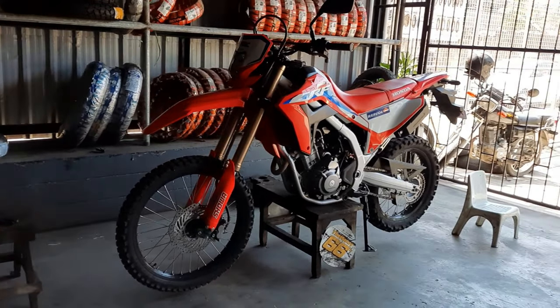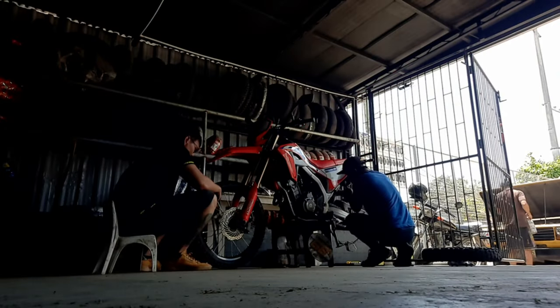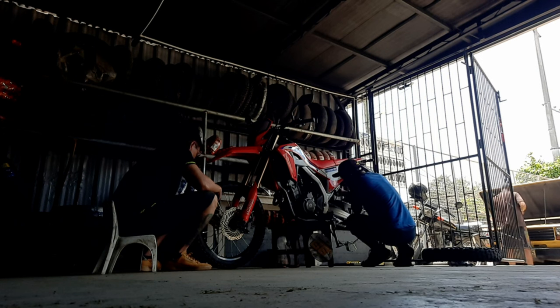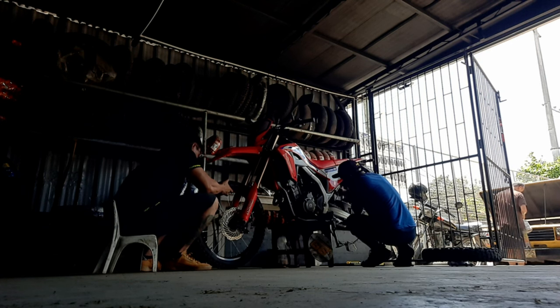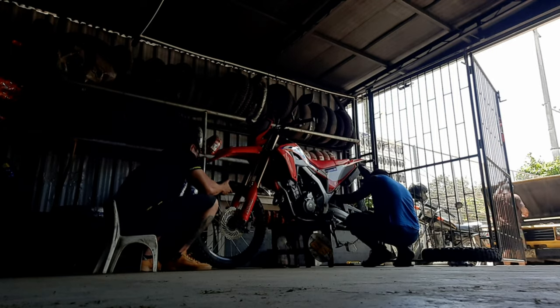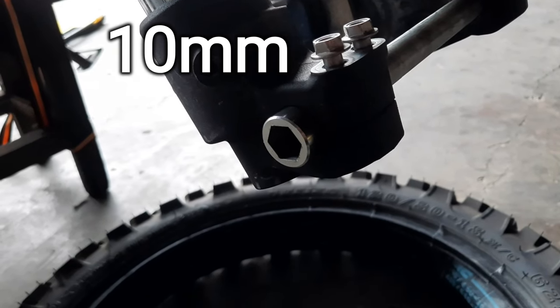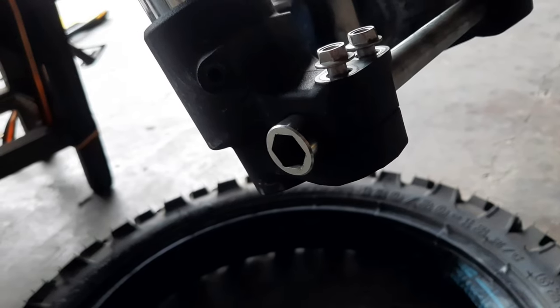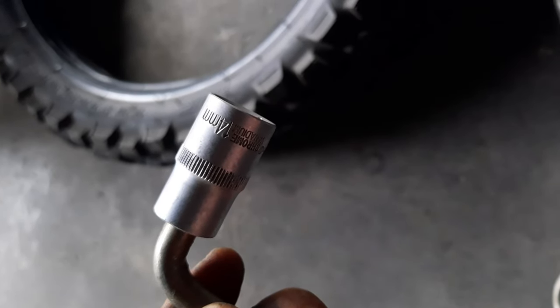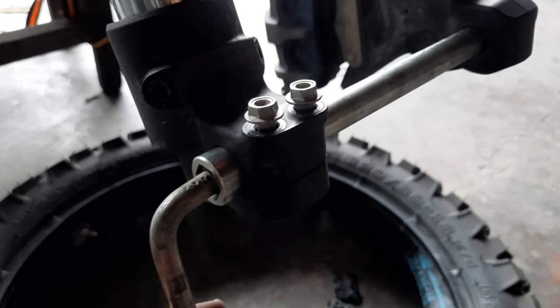Stay tuned because I will be giving you hints and tips if you are planning to do this yourself. First thing to do is to remove the wheels. We will be converting this bike into a supermoto because that's what my client wants. We will be using the stock front and rear hubs for this build since he will be riding mostly on the streets anyway. To remove the wheels, you will need a 24mm socket to remove the rear axle, or an adjustable wrench will do just fine. For the front, you will be needing a 10mm socket to loosen up the pinch bolts holding onto the axle. For the front axle itself, you will be needing a 14mm Allen key, or in my case, since I do not have one yet, a 14mm hex head bolt that I bet will do the job perfectly.